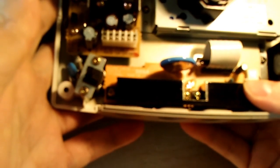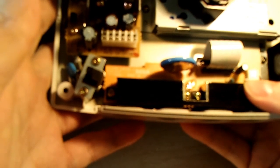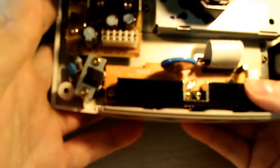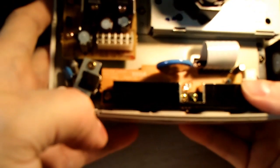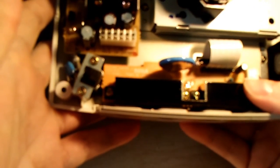So, again, it's up to you. This is one of those things. This is my pathetic attempt at a tutorial, but it goes with the same warnings as you would see in anybody's: I'm not responsible for what you do. I'm telling you from my experience. I've done it on a couple of Dreamcasts. I've simply connected the two pins together, and I've used any controller that I want, and I've never had a problem in years. Others will say different.